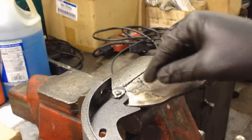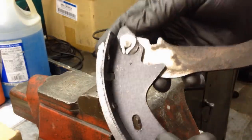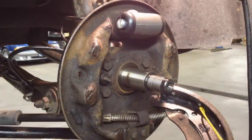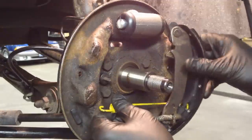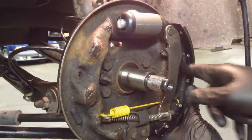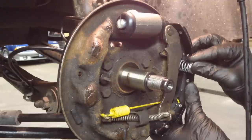Make sure the tangs are actually touching so it won't fall off — and you can freely move it without a bunch of slop or risk of it falling off. For the passenger side, this end goes in right here into the small slot and goes straight. Then put your shoe back up, and you can start concentrating on putting on your retainers. It just goes there, and then your new pin goes in from the back through the hole.